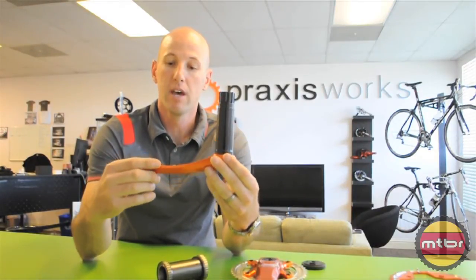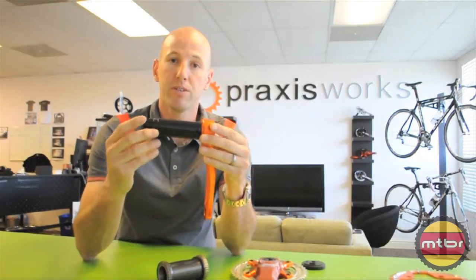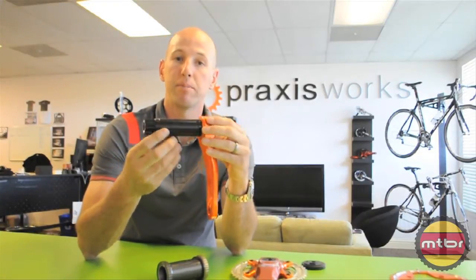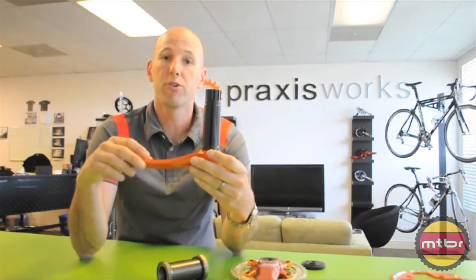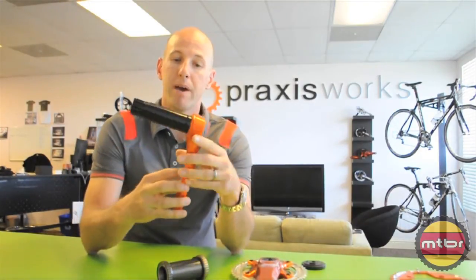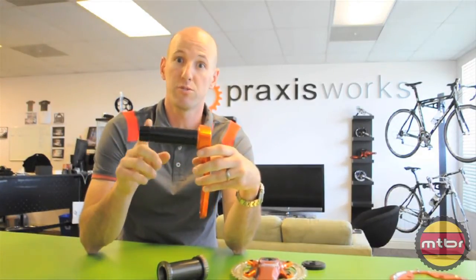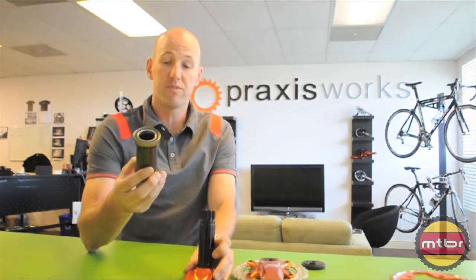35mm happens to be the point at which the size and the diameter of the spindle makes it easier to work with other materials. So that's why 35 happened to be the magical number for us, for rigidity greater than the 30mm out there, but also for future development. Imagine down the line carbon fiber, titanium, and maybe some other materials used for the spindles to get lower weights.